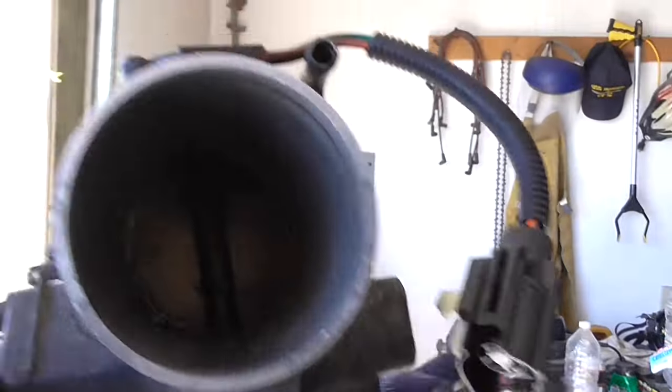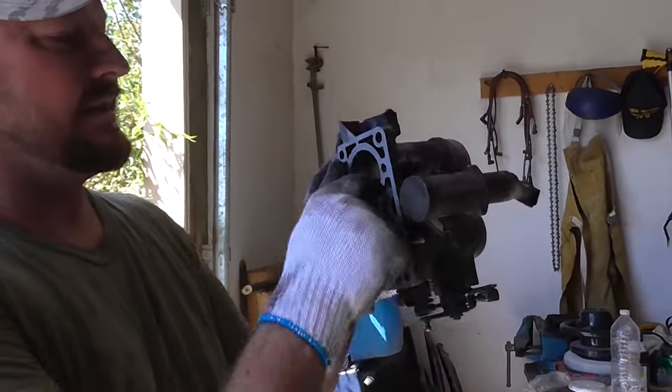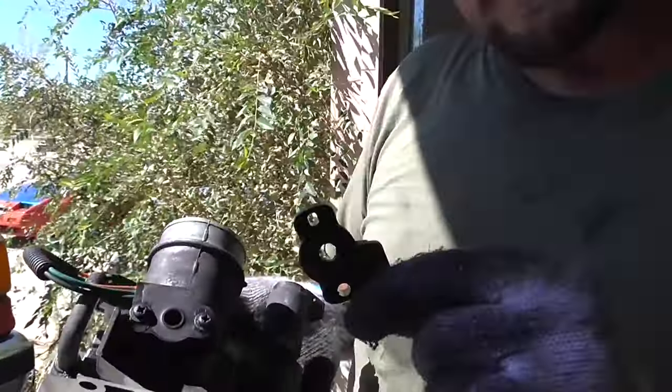We finally got it done. We cleaned the throttle body out — got it fairly clean, a lot better than before. I ran out of carb cleaner but it did the trick; it was all caked with a bunch of stuff and now it's opened up nice and clean. Installed the new throttle position sensor in the throttle body. All that's left is to buy a new gasket and put it back on just like it was before. I'm not going to show that part because it's pretty much just the reverse of what we've done. Brand new throttle position sensor in, old broken one thrown away.